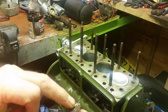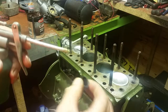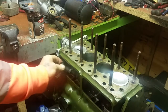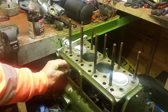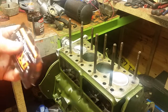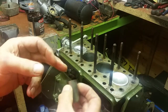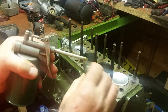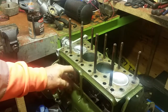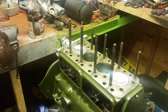Just a bit of assembly lube - you don't need to blather it all over, it's not cheap stuff. Just a little bit on the bottom of it, give it a squirt with the oil. Obviously clean all these cam followers up first, give them a good clean, because inside the bottom of the cam follower they'll fill with detritus over the years. You'll find they'll be running in a bit of sludge at the bottom, so give them a good clean out. Just a little bit of assembly lube on the bottom - you don't want it running dry on the cam while the engine starts.